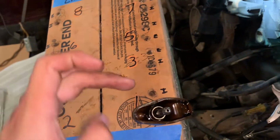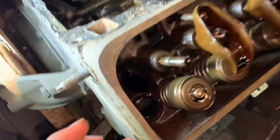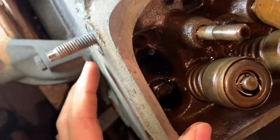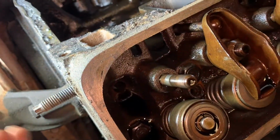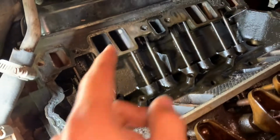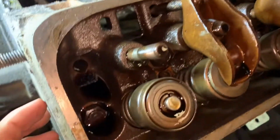Like I said, just go along the ladder there. Like I said, inspect the stud. You don't want this to be pulled out, because then you will be having a bad day. Because imagine putting this back on like I did. Everything was running good for like a day, and the next day it was misfiring, cylinder number 4 and 6 exhaust weren't hot. I was like, well, damn.